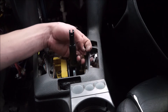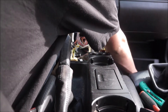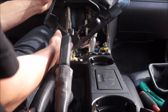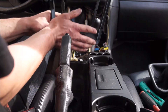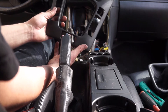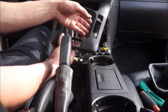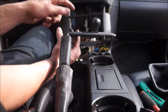There are a handful of screws all around here that need to come out to get this plastic piece out. Let's slow down and talk about this whole thing. Ignore the fact that this part is off and the manual transmission is in — I wanted to explain this quickly. On mine, a lot of the plastic tabs were broken because the previous owner wired the fan switch and didn't remove this panel properly. As a result, a lot of screws didn't actually need to come out for me, which made it simpler than it should be. Normally you'd need to move this section back to access the front screws. The screws on the side in the back are a little tricky.